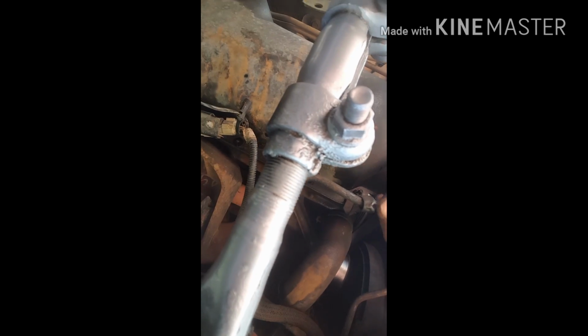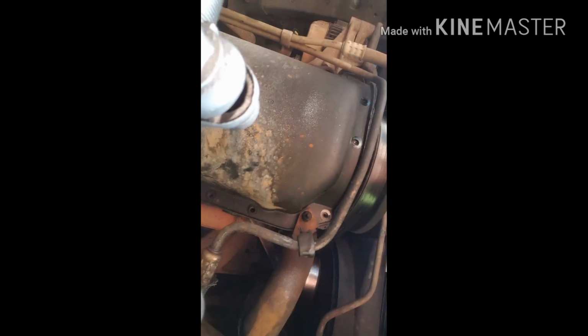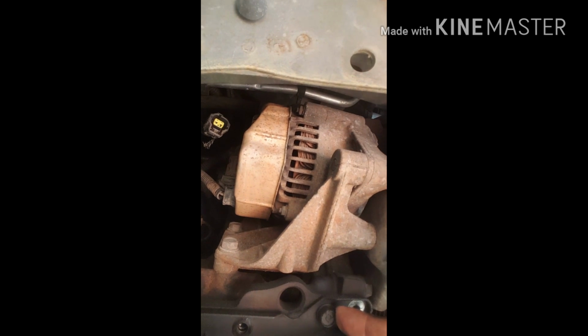Take off the oil pan, and for some stupid reason, like everything else, everything's a different size. Most of it's 7/16, but there is some, however, that I think are straight up a half. We'll see. I think they are, from what I can tell. And then you've got these plastic pieces. They might be rusted. You'll have to take them loose and everything else. Drop this oil pan out.